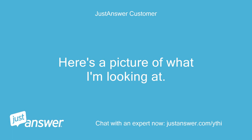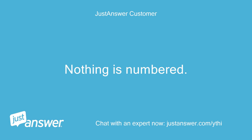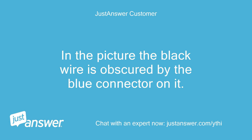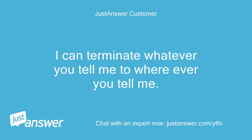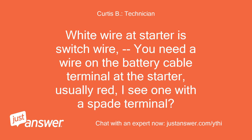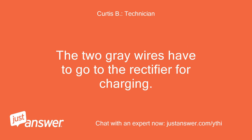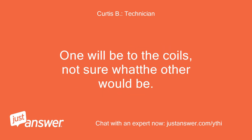Here's a picture of what I'm looking at. I have a five-post keyed switch in my hand — nothing is numbered, nothing is labeled. In the picture, the black wire is obscured by the blue connector on it. I run network cable for a living; I can terminate whatever you tell me to wherever you tell me. White wire at the starter is the switch wire. You need a wire on the battery cable terminal at the starter — usually red, I see one with a spade terminal — that has to go to BAT on the key switch. The two grey wires have to go to the rectifier for charging. The other two wires coming from the engine — you need to see where they go on the engine; one will be to the coils.